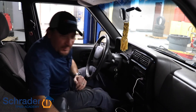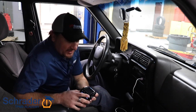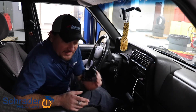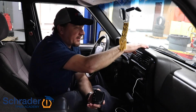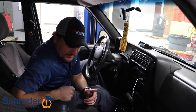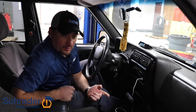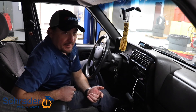Now that we've learned the IDs to the display unit, we're going to put the display unit on the dashboard. We want it on the dashboard because we have a solar power unit which powers this display. It comes with a little sticky device that you can set on the dashboard. Set your display on the dashboard and it should hold it right there. And those are the steps to follow to properly install and learn the IDs using a TPMS tool to your retrofit kit.